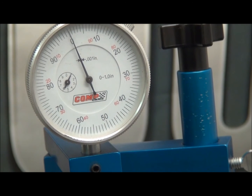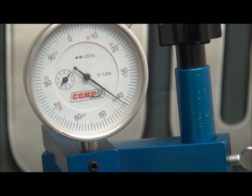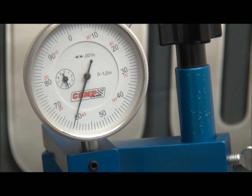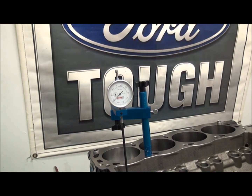All we're going to look at is to see when the lifter is at max lift. So we're reading 100, 200, 300, 360 — it's going to be pretty soon — 369. So 369 thousands will be the end. If you look at the cam card to see what the lobe lift is, take 369 times 1.6, or whatever your rocker arm ratio is. If it's 1.72 and so forth. The standard 1.6 puts it at 590.4.